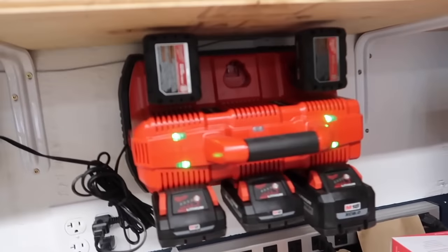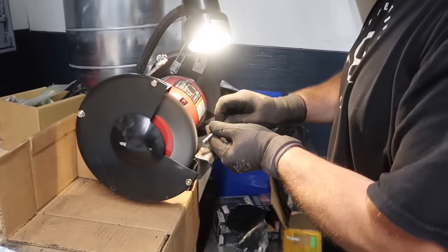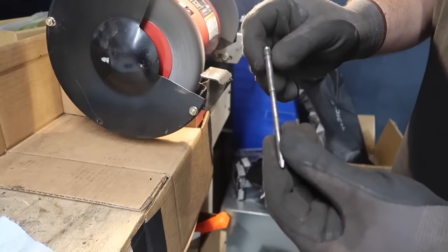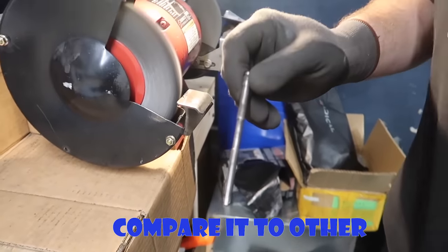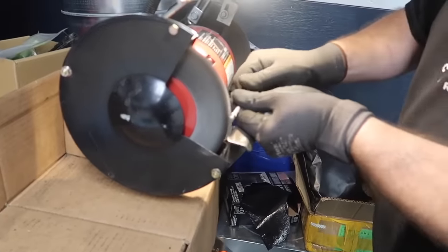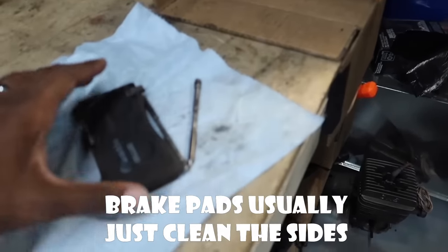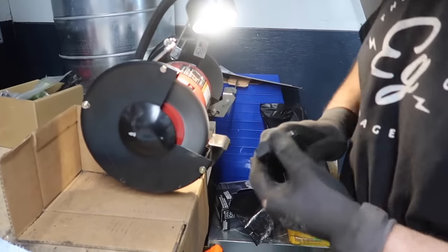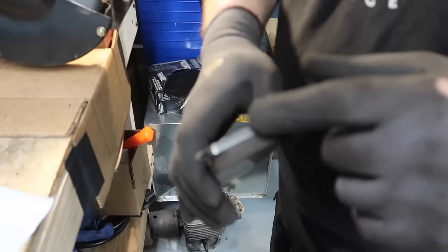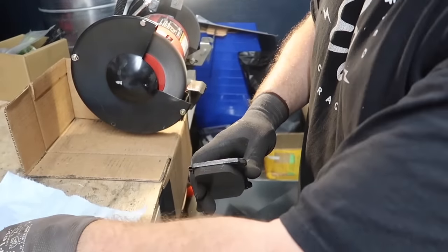What I do is use a ceramic grease. Everybody freaks out when you say you're going to lube the pads — but you're not lubing the braking material, you're lubing the contact points that slide. You'd lose your brakes if you lubed the actual contact surface. This is just the sliding contact points.